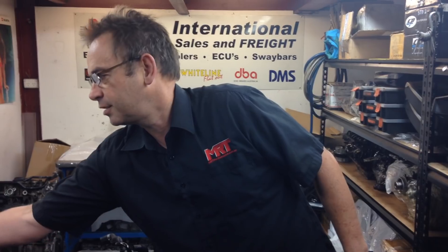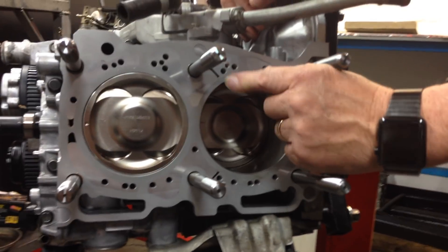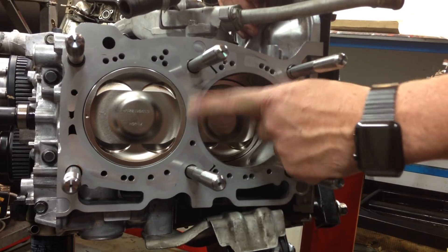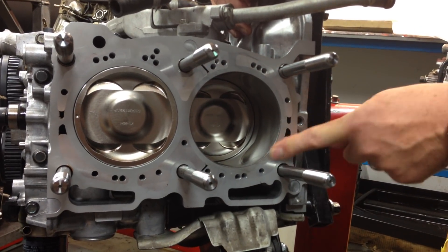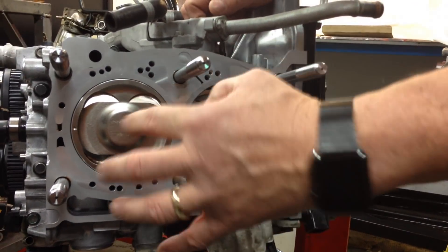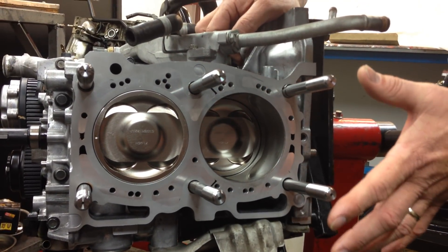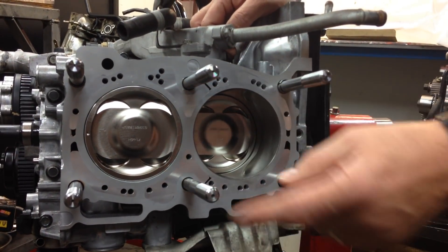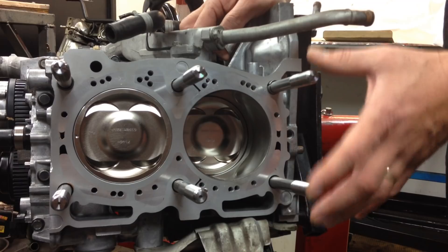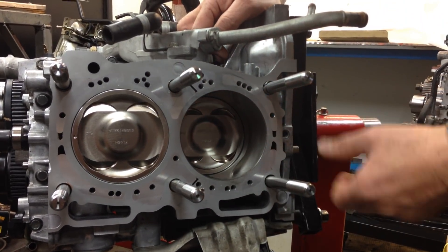Let's have a closer look at some of the parts in the engine and the closed decking. These blocks are properly honed, bored, and torque-plate machined to make sure everything is bolted together during machining, so when it all gets bolted back together with the original factory parts there's no risk of distortion. Because when you do up these bigger head bolts, if the block hasn't been machined properly you might not end up with the right settings.